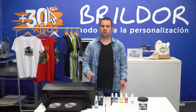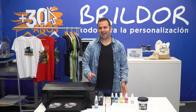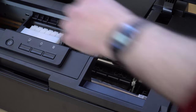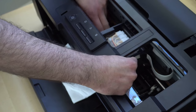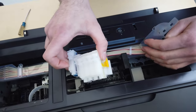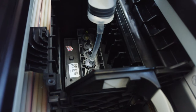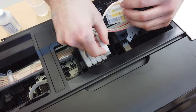Flushing: this consists in flushing the cleaning liquid through the nozzles of the head. There are two types of flushing — one without removing the head, and one by disassembling it completely. Flushing without removing the head: turn on the printer and when the print head starts to move, turn off the power using a power strip. Remove the screw and the print head cover. Put kitchen paper and slide the print head on top of it. Take out the cartridges with the help of a flat screwdriver. Pour some cleaning liquid into the container and slightly fill the syringe. Attach the hose to the nozzle and lightly press the cleaning solution through the print head. Repeat the operation on all nozzles, then put everything back in place.